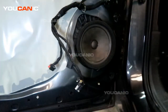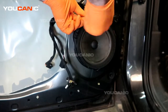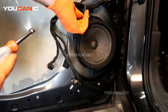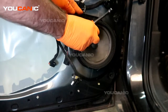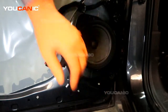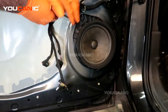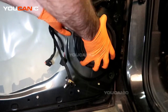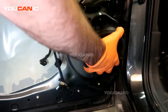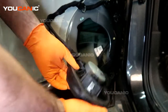That's how you get your inner door panel off. Once the door panel is removed, we have access to the speaker. There is one 7 millimeter bolt to undo. With that bolt undone, you can pop the speaker down — it has a lip on one side holding it in place, and there was a little clip, so you need to apply a little pressure to get it to come out.